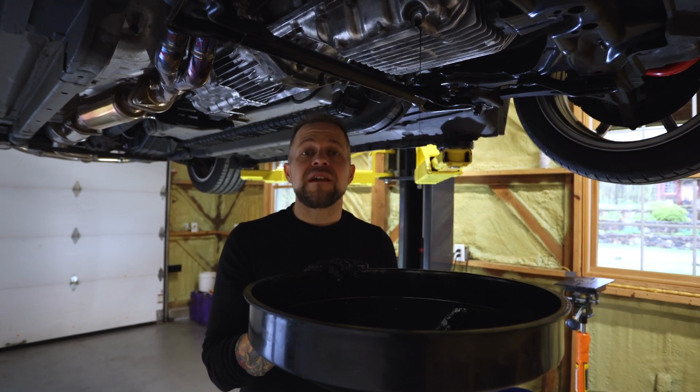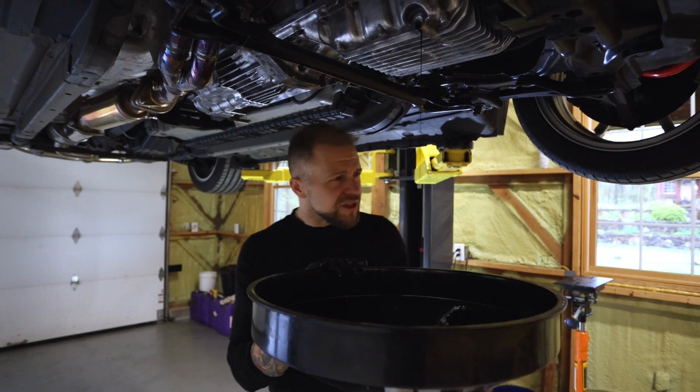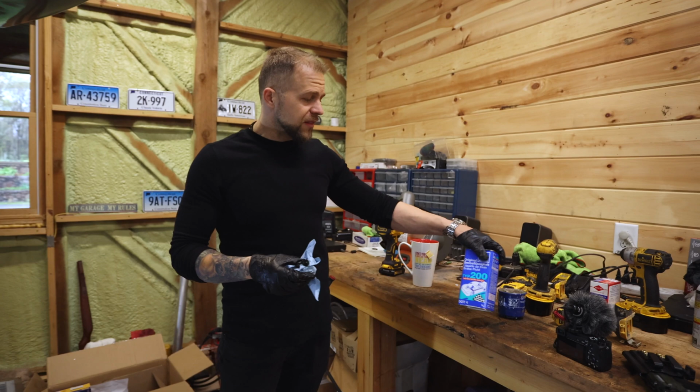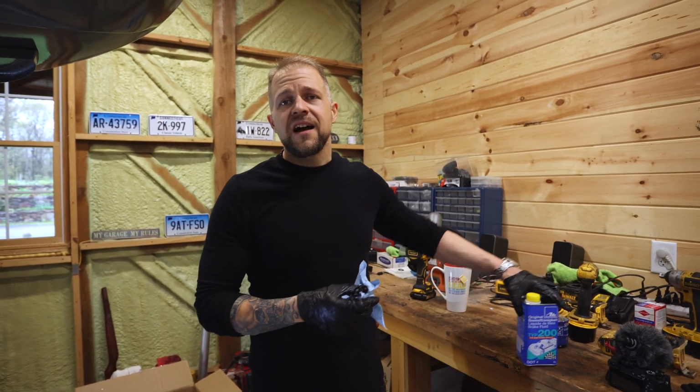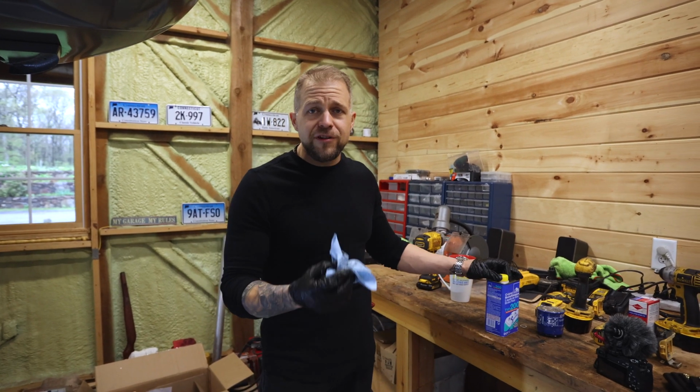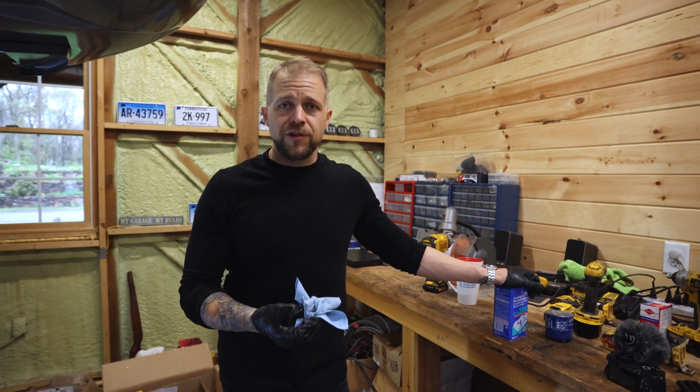And that is a terrifying experience when you're coming down a straightaway at full bore. So having a high performance brake fluid, I'm using ATE Type 200. It's a DOT 4, but the key here is that this has higher temperature management. Motul makes great brake fluid, but whatever you do, make sure it's a proper racing brake fluid.